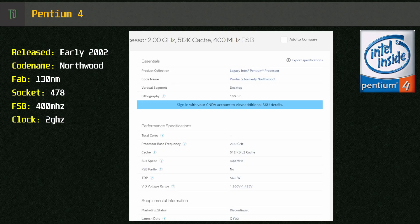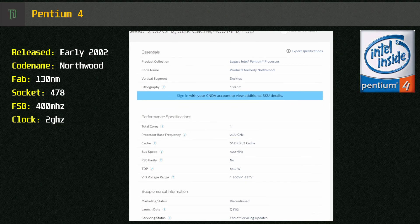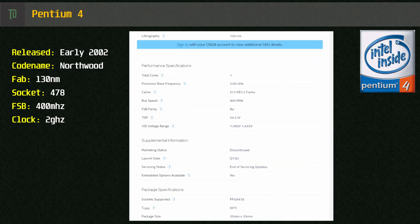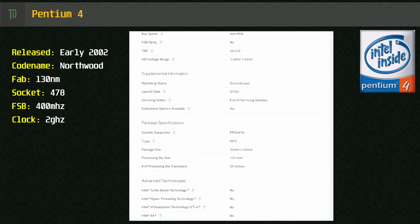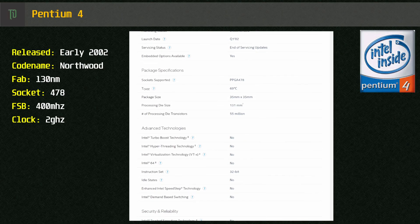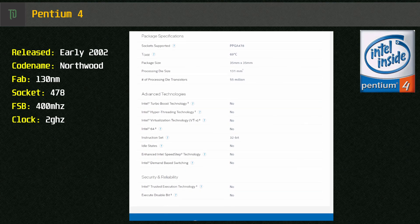In this build we're using the Intel Pentium 4 CPU — a 2GHz variant based on the 130nm Northwood architecture, released in early 2002, and one of the first ones on Socket 478. At the time, its main competitor was the Socket A-based AMD Athlon XP 2000+, but it also had to compete with the aging but popular Pentium 3 Tualatin chips, which were dropping in price and still giving good performance.